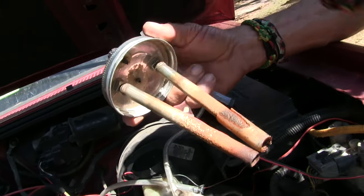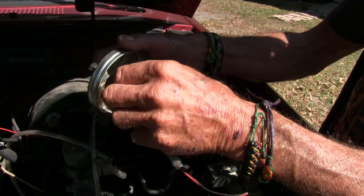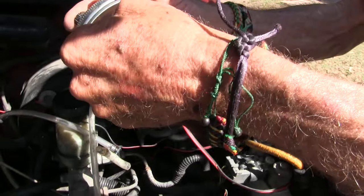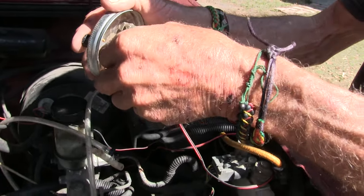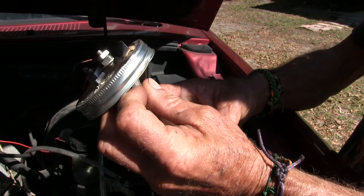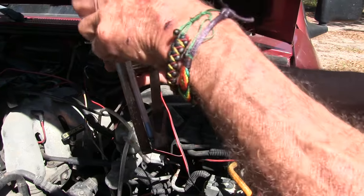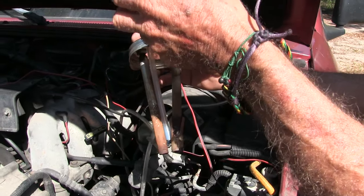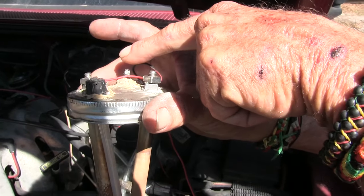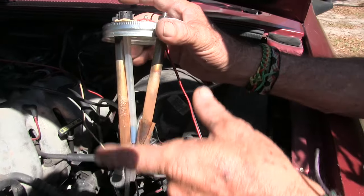Now, very important that you put this piece on the right intake here, because this is going to be under the water. The one that you can adjust — this one I've got set in a fixed position but this one turns and you can adjust it. This one does not go into the engine, but this one will be going into the engine. If you hook it to the wrong one, you're going to pull water straight up into your motor. So you attach your bubbler to this piece here.